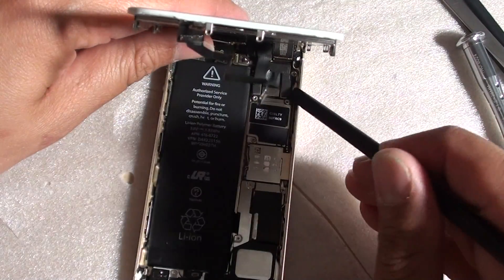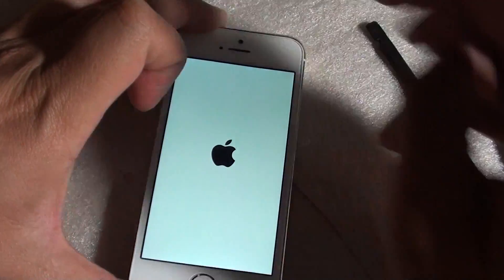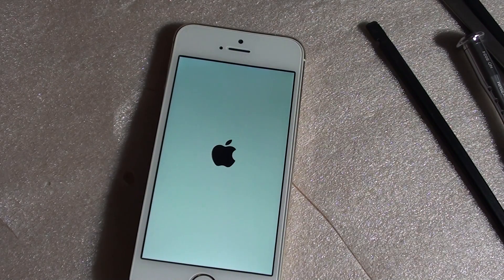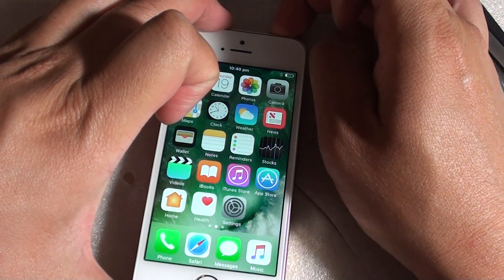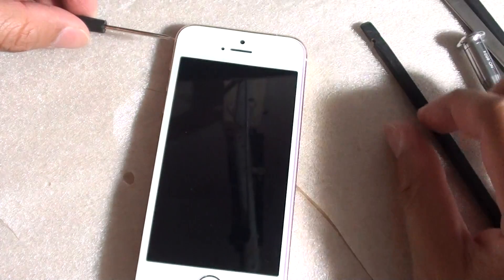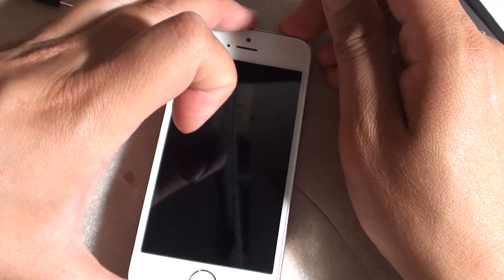If we take out this camera cable and switch on the phone, we can confirm the cause. If your camera cable worked before and you never had any issues, then that flex cable is causing your phone to keep rebooting — in the process of replacing the LCD, it could have been damaged. You might want to get it replaced. In your situation it might not be the camera cable — it could be another cable causing the issues, so you just have to test one by one. But in my case, after replacing the LCD, that camera cable is causing the issue, so I am going to replace it.